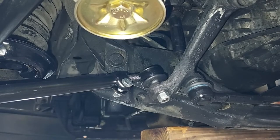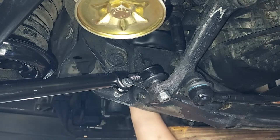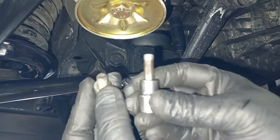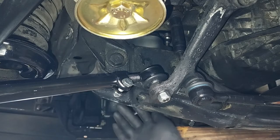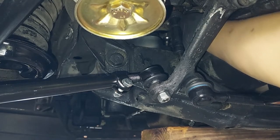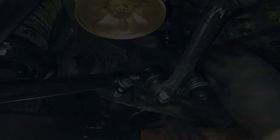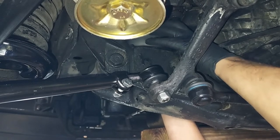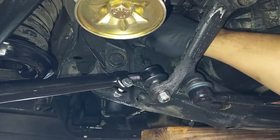All right, hopefully I have the engine raised up enough. And I'm going to slide this in from the front where we can get this. Yeah, there we go. We can get that new mount right there. And basically, I'm going to take the socket and the bolt, and we're going to try to get this inner one started. All right. That is very tough to get that one in there, guys. So I've got it started. It is now on the frame. Now it's just a matter of getting it tightened down, doing it with my two fingers, and then once it's down there at the final stretch, we'll give it a snug with the socket, with the 3/8 drive. All right, now before we snug it down, we want to go ahead and get the other one on the other side of it.